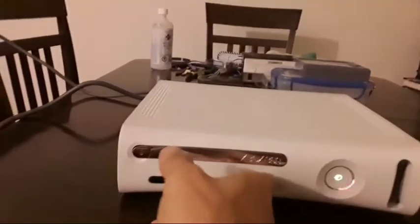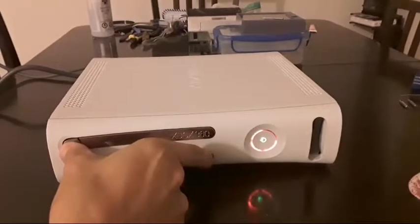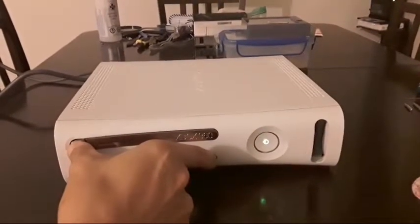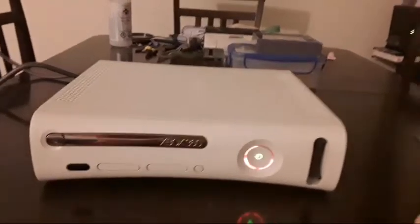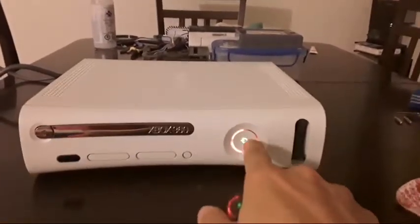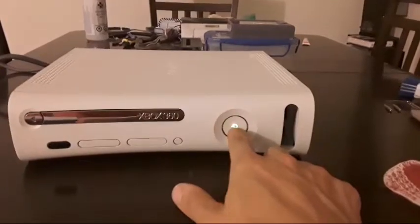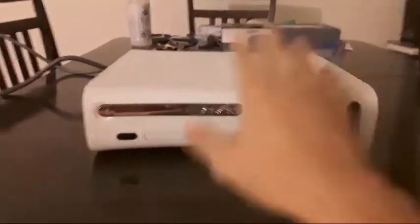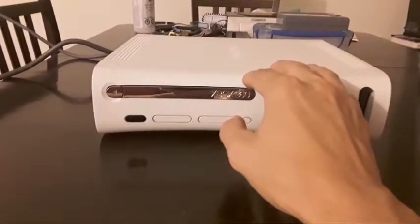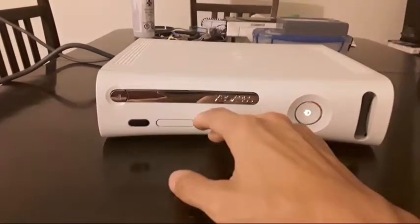Something cool I learned — I'm going to try to do this on camera. We got 0031. That's how to get your secondary error code: hold in and press the sync button, then click the eject. Four red rings is a zero, then three, two and one. So this one has a 0031 secondary error code, which indicates too much pressure on the GPU or disconnecting solder underneath the board to the video RAM.